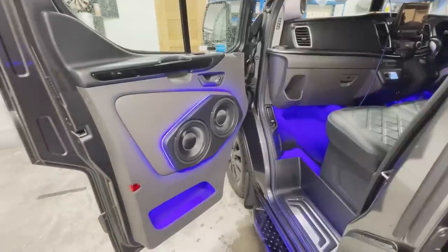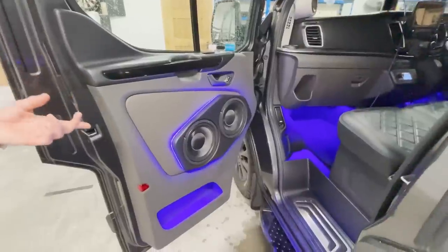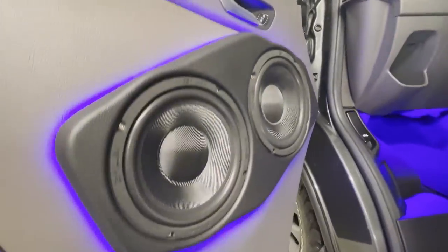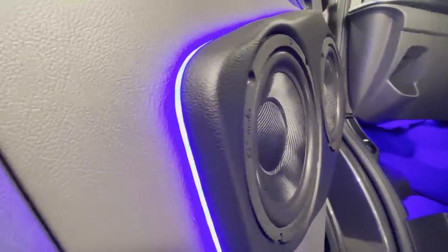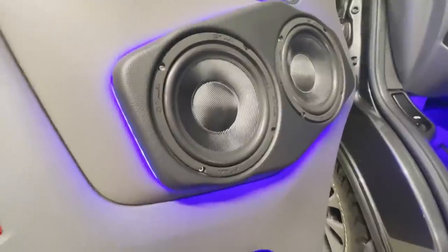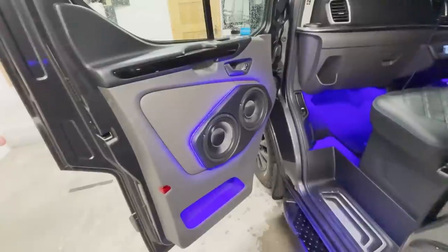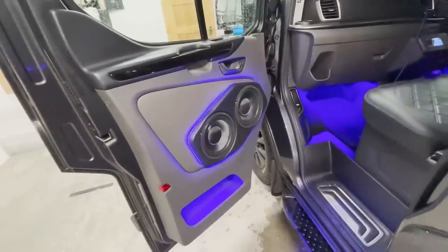They've actually got a glass fiber voice coil former. So obviously they de-sleeve if you cook them too hard. The idea was that half the coil is wrapped on the inside of the former, and the other half is wrapped on the outside, so the thermal expansion is matched. So they don't de-sleeve. It's 200 watts RMS each. And now we have 630 behind them. Yeah, they're pretty hefty, so that's what I wanted.